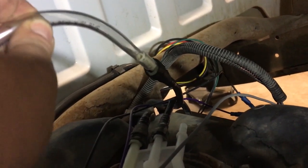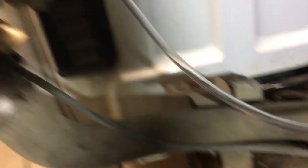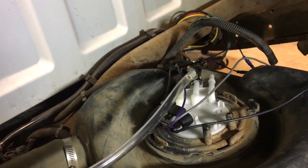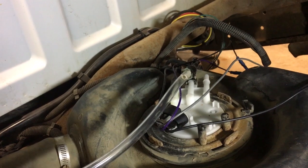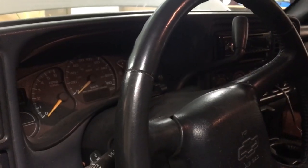I just shoved that plastic hose barb about an inch into this plastic hose. So we're back under the truck — you can see I've got my plastic tubing hooked into the return line coming from the fuel rail, and it just goes up and into the filler neck. I've stuffed about two feet down in there so it shouldn't come out. Now I'm gonna open up the garage door and fire up the truck and see how my fuel pressure is at idle.